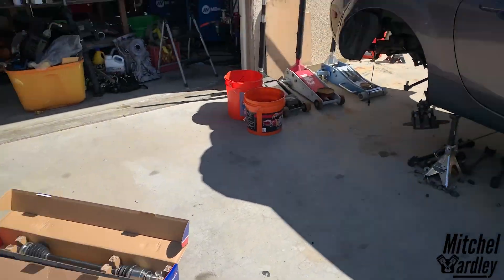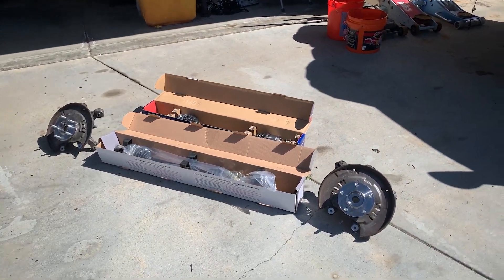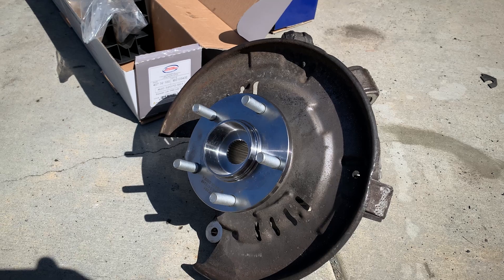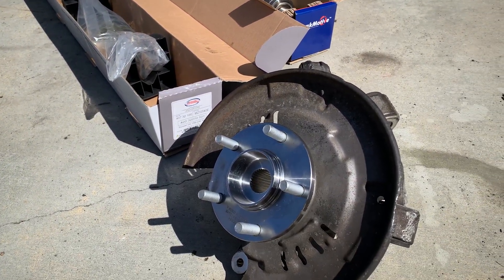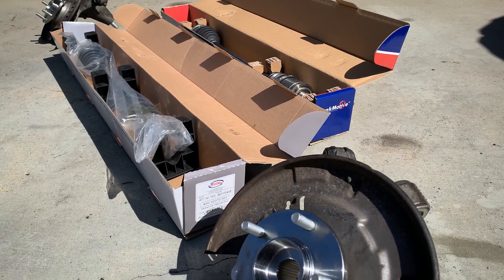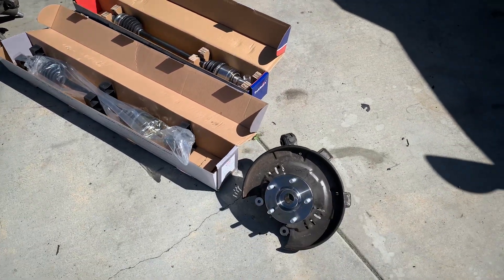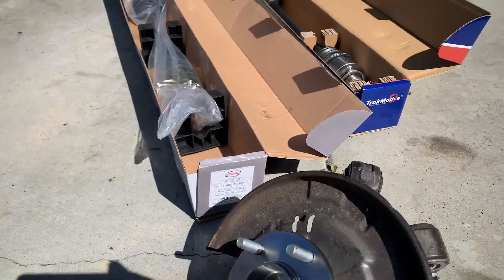Welcome back — some progress on the car. I wanted to do RX8 rear upgrade stuff, the hubs and axles, but I didn't want to search for the knuckles. There's also a part of the write-up where you have to take the end of a stock NC axle and cut the half-shaft, and I didn't really want to mess with that. The OEM hubs are prone to breaking, and with this car at 230,000 miles...